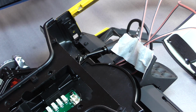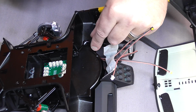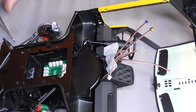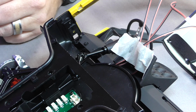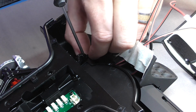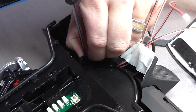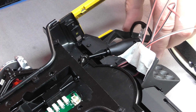And this is the top then that's going to go over to pin that into place. So line that up. Make sure the pin goes into the other side of that steering housing there. Or that little bracket. And then hold that in with a Q screw. Which I've got here. And then once this is in, this will be permanently attached. Nice and tight. And there we go. The steering is now attached to that linkage there.